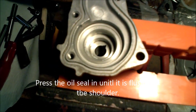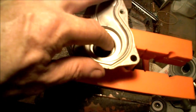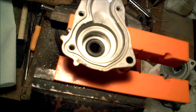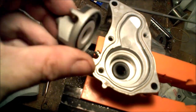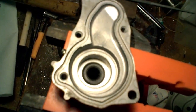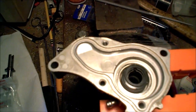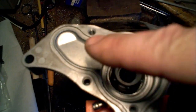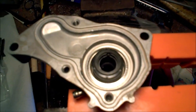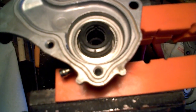The other half of the mechanical seal is on the back side of the impeller, so I'll need to pop that off. Then it's a matter of finding the right size socket and pressing the oil seal in until it seats, with the lip facing the engine side. The oil seal is just pushed in flush. It's rubberized around the outside edge so it doesn't need any sealant between itself and the housing — it pushed in pretty easily. Same thing with the impeller side of the mechanical seal — rubberized around the outside, presses into the recess quite easily. For the mechanical seal itself, I found an inch and a sixteenth socket was a fairly close fit and gently worked around keeping the seal square, driving it in until you can hear the change of tone that tells you it's driven home. This one also had a rubberized seal around the outside.